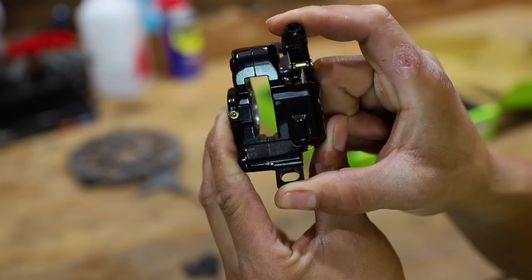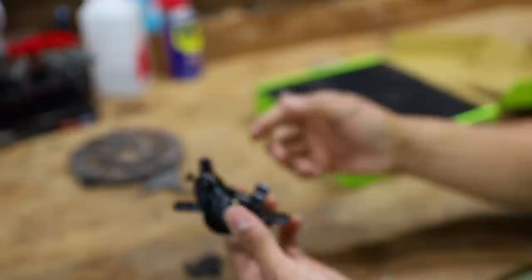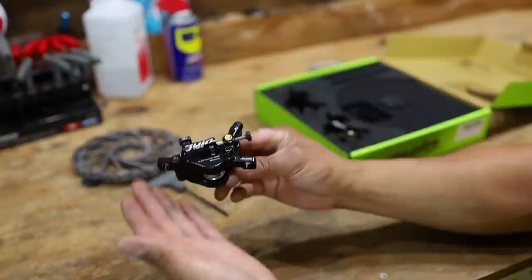Let's go ahead and look and see if both of these pistons are going. I'm not going to give it a big squeeze. Do you guys see the pistons? Let's see if both of them actually work. Yep, they're both going. We are in business. The nice thing about it — I don't know how much riding you're going to actually do to have to bleed these things, but theoretically you shouldn't ever have to bleed these. It's not a messy job. Though if you get them really hot enough times, yeah, you're probably going to have to bleed them.